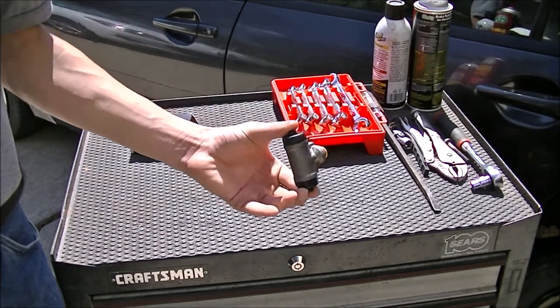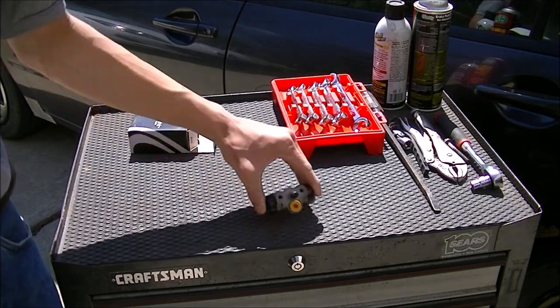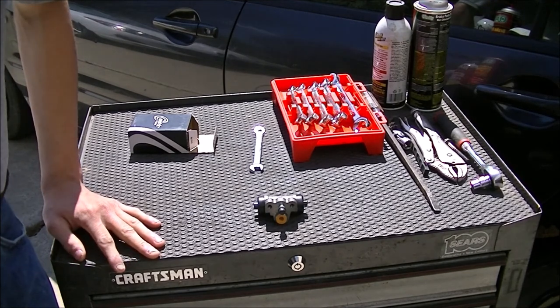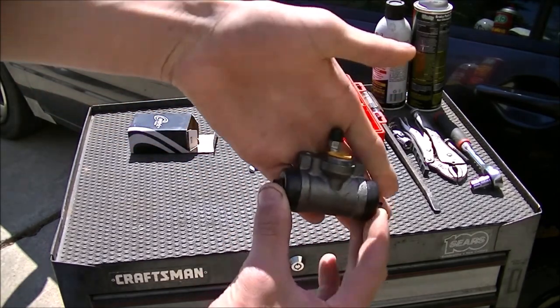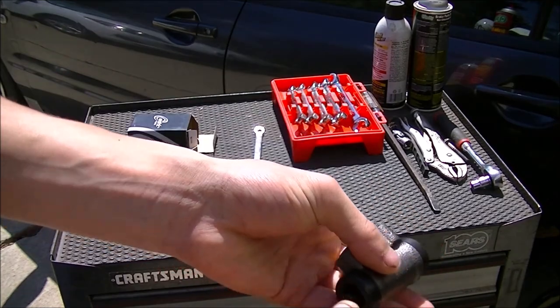Removing the brake shoes would be ideal in this case because my brake shoes are very worn out, but I'm going to remove the wheel cylinder without removing my brake shoes since I'm going to do that on a later date. Here's the wheel cylinder. This is the part — usually these boots get worn out and they start to leak, or they'll leak right where the shaft ends.